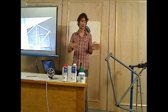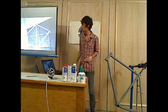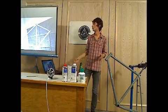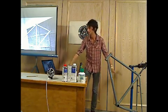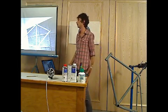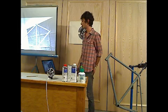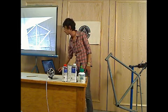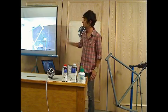And the one I use now, it's yellow, is a gigantic thing. It's a side downflow, basically, and it's big enough to paint a train in. So the air just comes down from the top and filters down through the side. So it's a lot cleaner than this booth ever was, actually. So it's nice. But so all different kinds of booths. This is just what I've happened to use. You can see how dirty the filter is going to get. You've got to change those once in a while.